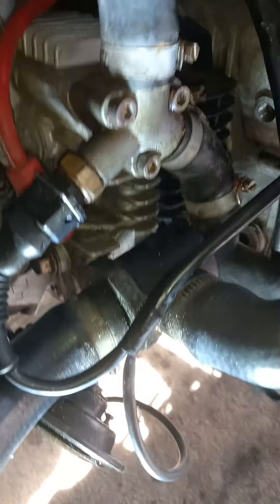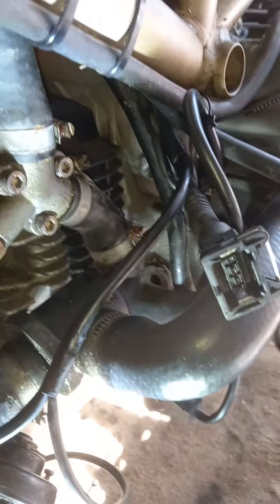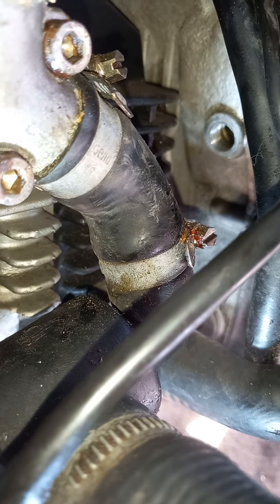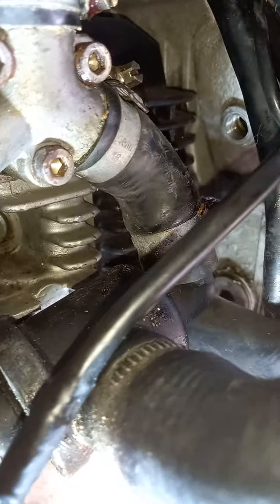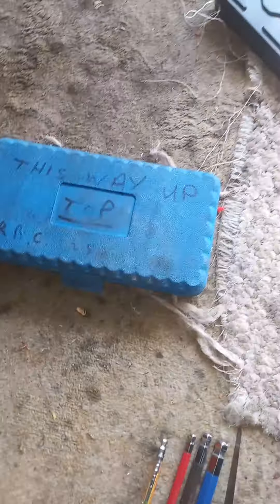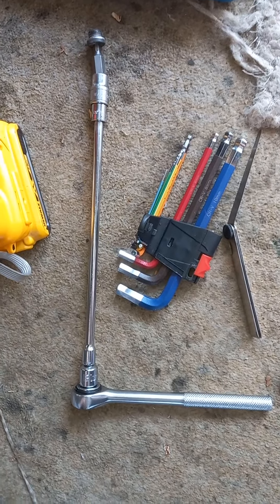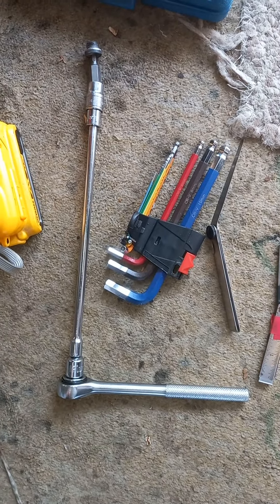I thought I'd just let you know a couple of useful things. Don't be put off by all the cables getting to the crank sensor — there it is. Just check that measurement: the distance between the crank sensor and the actual gear. It's just a bit awkward, but you can get the wires and pipes out of the way and pull it out. I've put together a long-reach tool — you can see it here — quite a long reach. Just push it through; it does undo, though it's done up to a tight torque. Anyway, catch up again, thanks for watching.